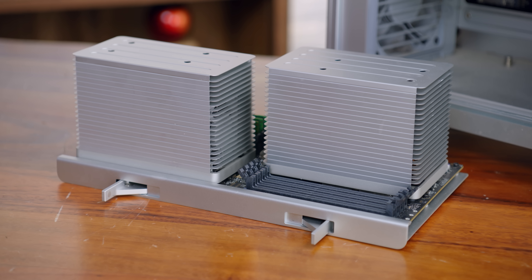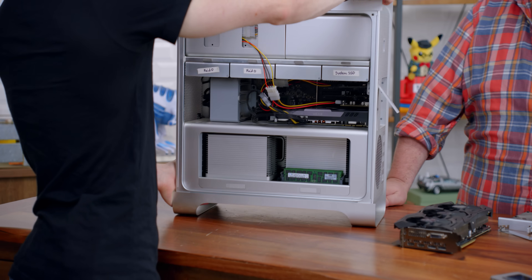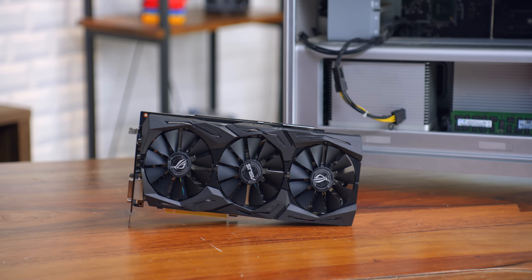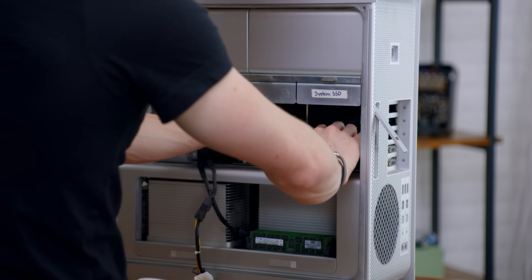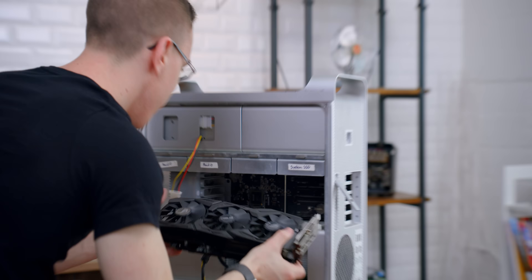Single thread is probably not going to be super impressive, but what we're using it for is primarily editing. I do play the occasional game. You'll definitely be able to game — I love my Civilization. So we've upgraded from a quad core to 12 cores, and this entire setup with the new tray, dual CPUs, and 64 gigs of RAM still cost us only about $700. We went with an RX 580 AMD card — this is pretty much the maximum the system can handle. This is the original connector, a pair of six pins, and you've adapted a six to an eight — which is already bad. Have we even measured to see if this Strix card will fit? I eyeballed it, it'll be fine.